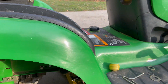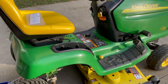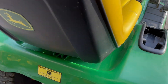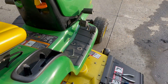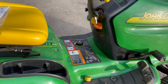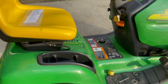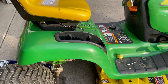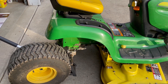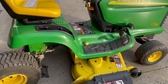On this model, the fender is all part of the frame — it's all welded so you can't take the fender off. On some other models you can get the fender off: there are a couple bolts behind the seat, you take off the pedals, some bolts go up and underneath the floorboards, and you take off the knob for the seat height control and undo the safety switch wire for the seat — then you can lift that whole fender off if you can't access it by taking the wheel off. But on this one you have to take the wheel off and get in there that way, or you'd have to drop the transaxle, which is way more work. Hope this helps — thanks for watching.